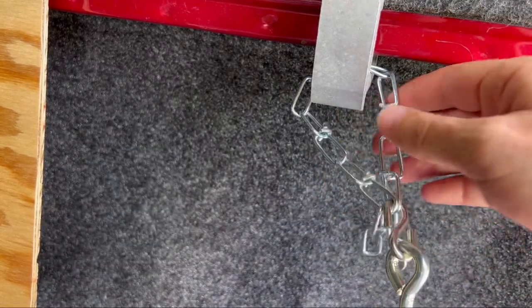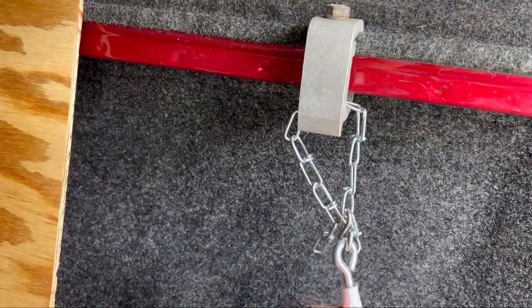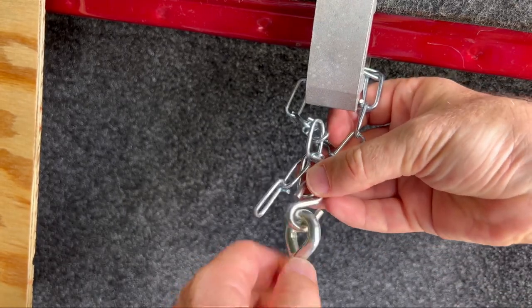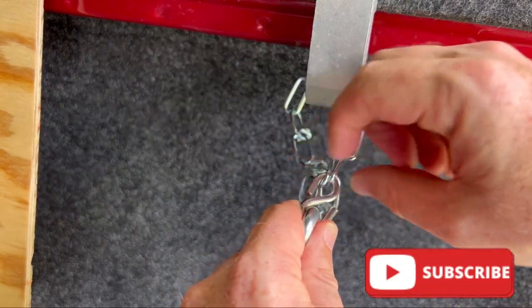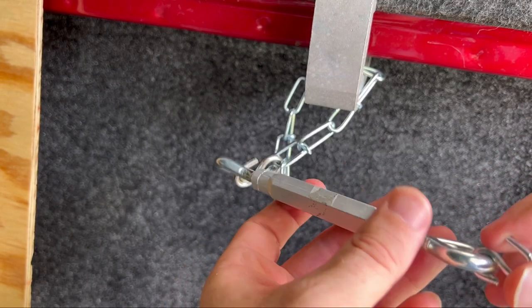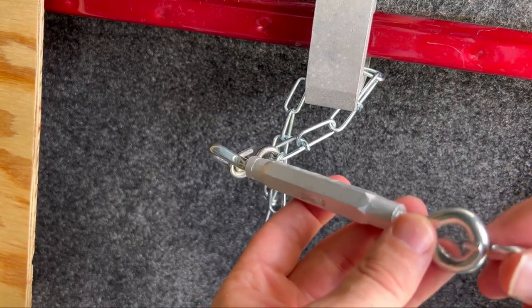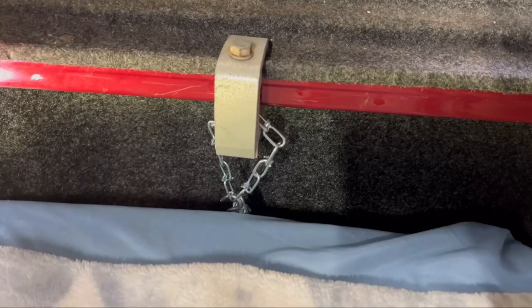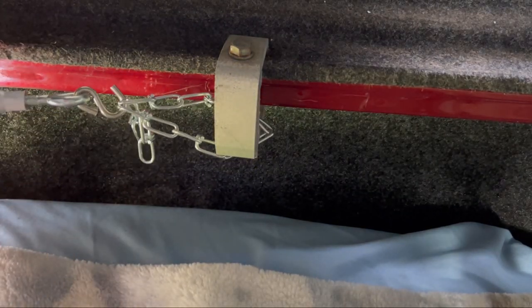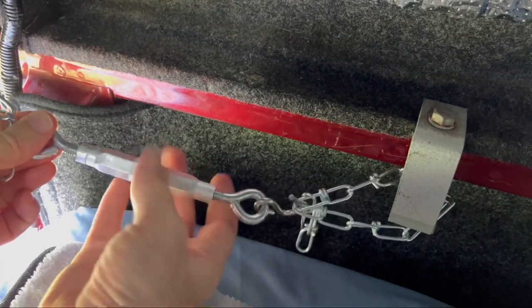To secure my camper from the inside, I bought this chain at Lowe's and just wrapped it around the clamp that connects the camper shell to the truck. I got this turnbuckle and also an s-hook — I closed the ends on both sides after getting the chain and turnbuckle through. There's a smaller s-hook on the other end that I'll probably replace. You put this one in the same way, just on the opposite side, then turn the turnbuckle.